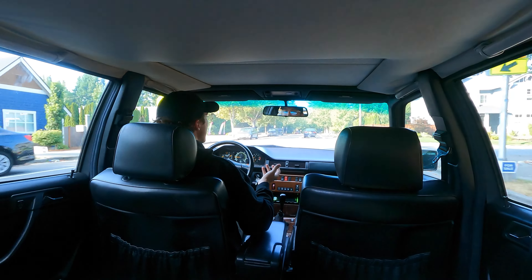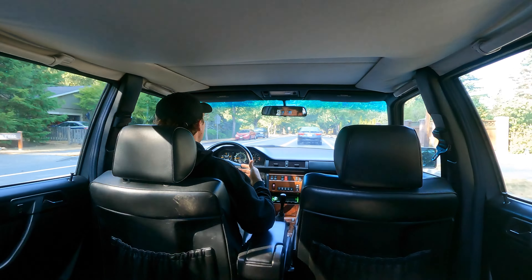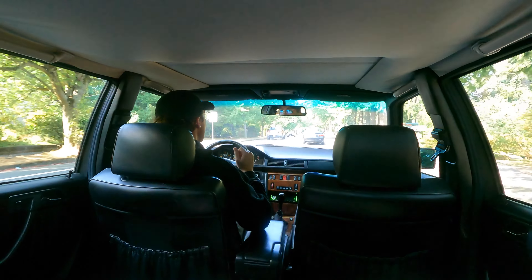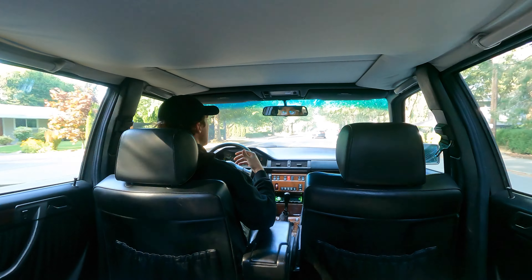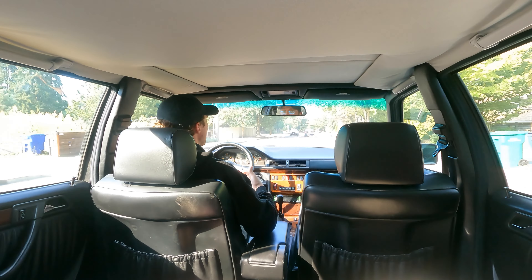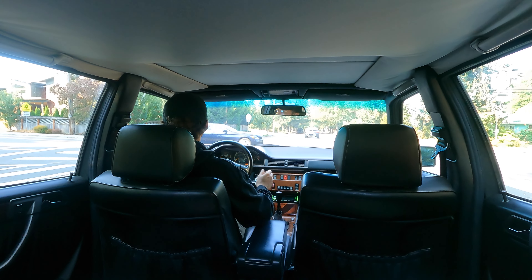One other thing I wanted to point out — one of the biggest differences between this and the C55 is that this has a single mass flywheel. It definitely revs and drops revs a lot quicker, so that's another thing to get used to in the whole setup. If I try to rev match, I really have to punch the gas pedal on this one to keep it at the RPM. Part of that is also because it's still set to park with the neutral safety switch, so the car probably isn't letting it rev as fast as it normally would in neutral, but it seems pretty similar to how it was revving before.